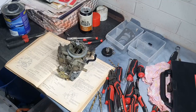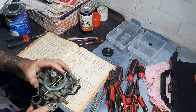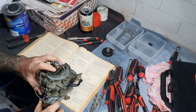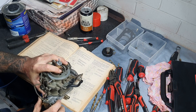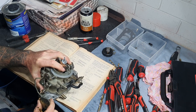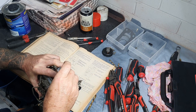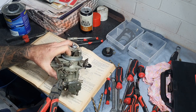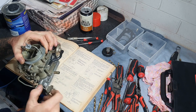Converting to metric, 0.235 to 0.265 inch is six to six point five millimeters. So at full throttle on the butterflies, you move this choke butterfly around to that position, then put a drill bit down the side. The six mil bit is a little bit loose and six point five just doesn't go in — so it's in between that range, which means it's correct. If it was wrong, you'd grab the pliers on this little tab and bend it up or back.